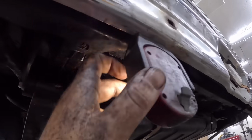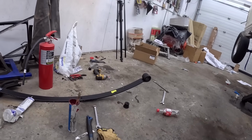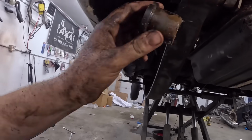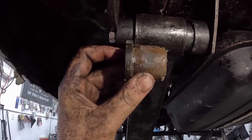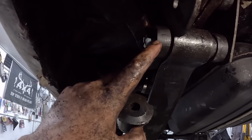The back. Getting the bushing out of the subframe was a nightmare. Now, the Energy Suspension ones, as you can tell, I drilled them out to get them out. So I put them in, but look at how much narrower they are. When I got the shackles, it actually came with these original style bushings, which I didn't know at the time. That was pretty sweet.